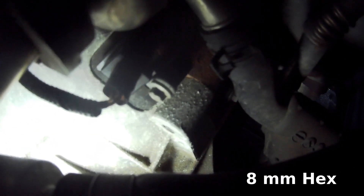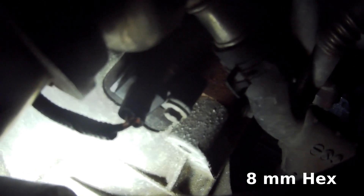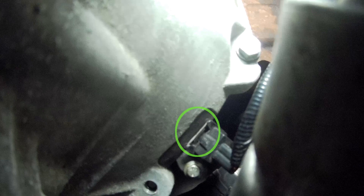It's held on by — I think it's an 8mm bolt — and there's a little clip on it on the cable. To get that off you need a little flat blade screwdriver and pull the little metal locating pin. I initially tried to get it off without that, but it's probably best to take the cable off first. Once you've got the metal pin off, the connection will just pull off.